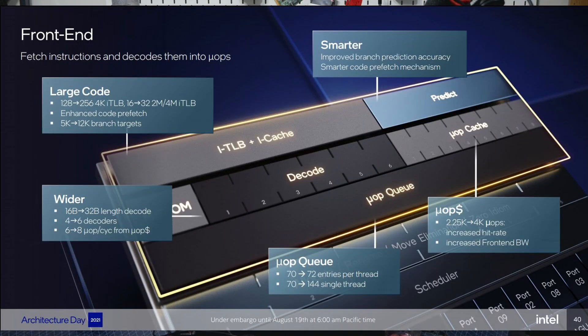For this design Intel is using its new Golden Cove cores announced with Alder Lake — pretty much the same core. It has a six-wide decode engine, which is up 50% from previous Intel generations. The whole pipeline has been widened: more page walkers, bigger reorder buffer, more execution ports. The L2 cache has increased from 1.25 megabytes in Alder Lake to 2 megabytes in Sapphire Rapids. Intel hasn't stated the total L3 size — which would reveal the core count — but has said it will be more than 100 megabytes on the biggest chips.